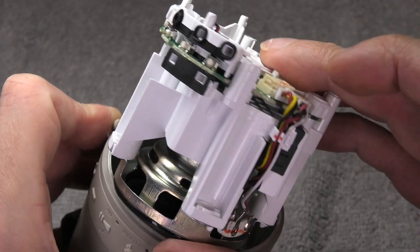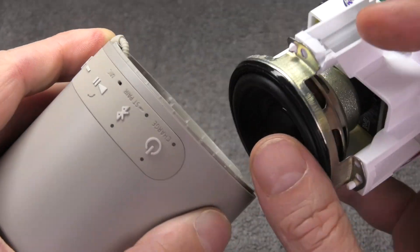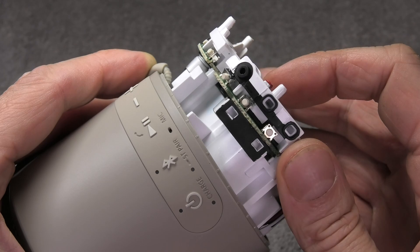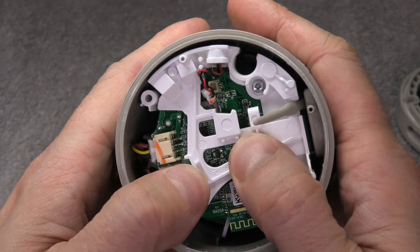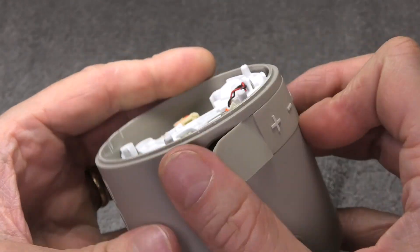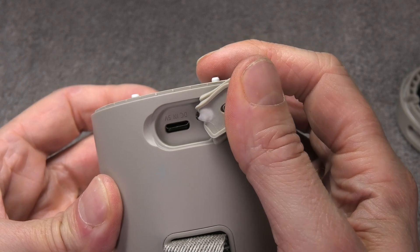Just make sure you have this aligned correctly — I'm using the power-on button as a guide. You can see the foils to the right, and I'm making sure this aligns with the button on the outside as well. It should be relatively easy to get in. Just make sure that the rubber piece from the USB port cover isn't in the way. I'm checking that everything is aligned by looking into the charging port from the outside, but the USB port isn't really accessible at this point, so something isn't right.